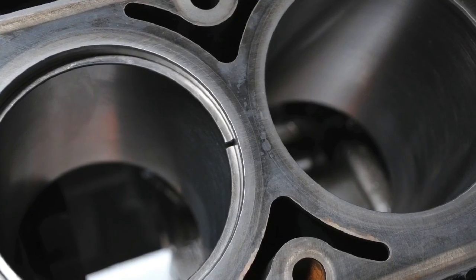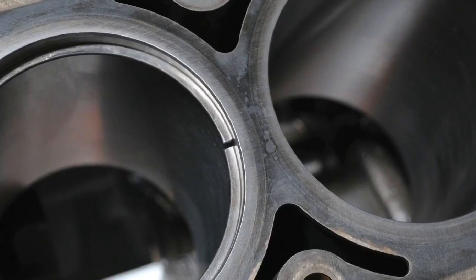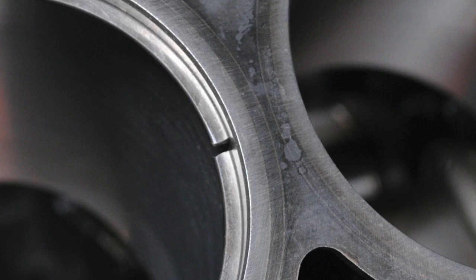Not just about what ring gap you should use, but what ring gap is, why there's ring gap in the first place, how much you should use, should you increase it — all of that stuff. So: what is ring gap? If you take a look at piston rings from any manufacturer for any motor — whether it's an LS, big block Chevy, small block Chevy, modular Ford, whatever — any motor has ring gap in it. If you take a look at a ring in a bore, you'll see that the ends of the ring don't touch, like in the photo. The rings don't touch for a good reason.